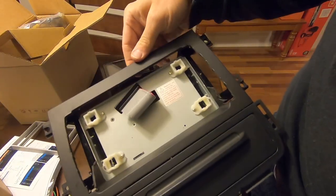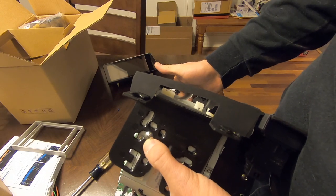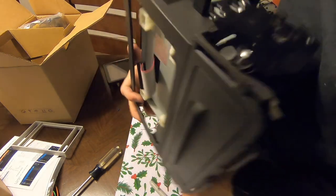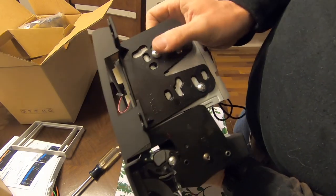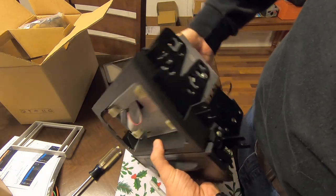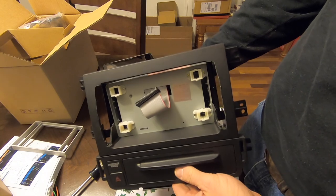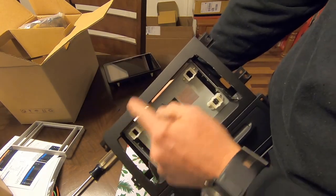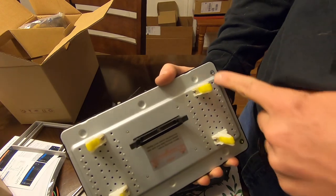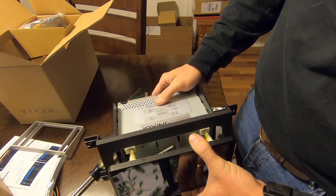Here's what I had to modify: on the sides I put the mount in the lowest position and had to drill out and extend the mount holes — same thing on both sides. I tilted the screen so the radio is angled back to match the pitch of how the factory radio was installed. I also had to enlarge this opening in the dash kit, which allows this protruding edge to sit back inside and get as close as possible to flush.